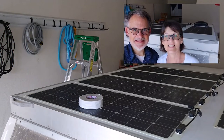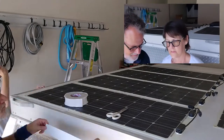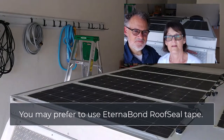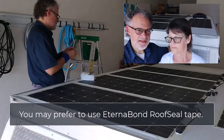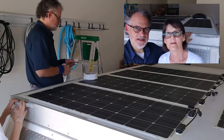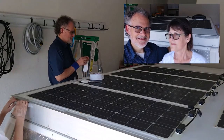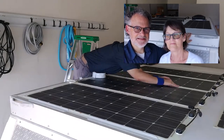The solar panels are stuck and fastened onto the roof. What we're going to do now is add a bit of roofing tape we've used on past projects along the leading edge — the edge that faces the wind. The tape we've got, I'm not sure it'll hold in 70-mile-an-hour winds, but if we take the leading edge down I think we'll be in great shape. We'll take the leading edges down on all five panels so they won't come off. We'll be able to tell if the tape is tearing after our first adventure in a couple of weeks, and we'll let you know how that goes.